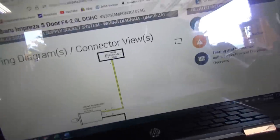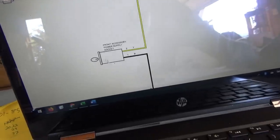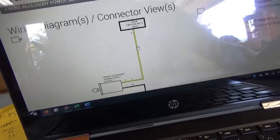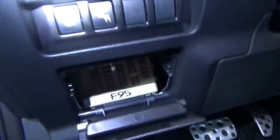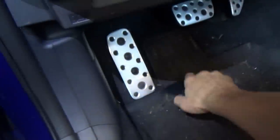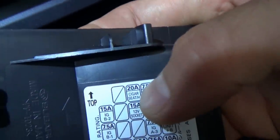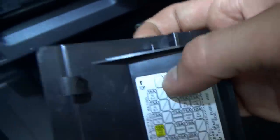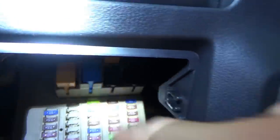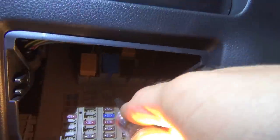The wiring diagram is very simple. Fuse number two, an accessory fuse — hot in accessory. Here's the front accessory power supply socket and a ground. Checking fuse number two under the dash — it's a 20-amp fuse labeled cigar and seat heater. The one below is a 15-amp fuse for the rear socket. Both fuses test hot on both sides, so the fuses are good. We're missing power and ground to the socket — it certainly sounds like it's just unplugged. Let's get it out and see.